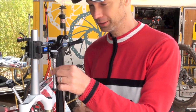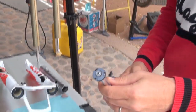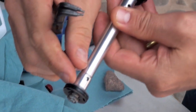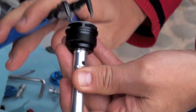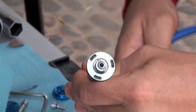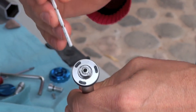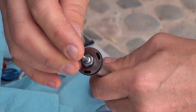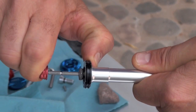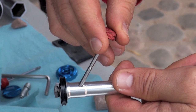I've got the same unit also here as a dry part. And here you can see some really nice details. So the oil is flowing through these three ports normally, lifting up the shims here. And once I close with my dial on top these holes here, the oil can only flow then through the center port. And you see here, here's my blow-off valve. So lifting up this blow-off valve, and the oil will come then through here, getting out through these ports.